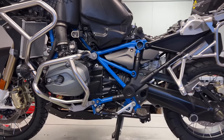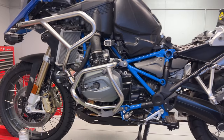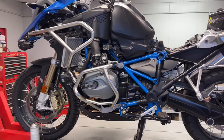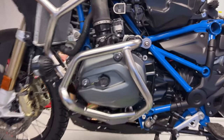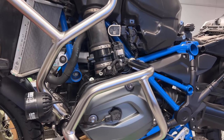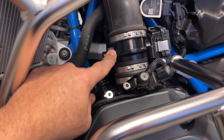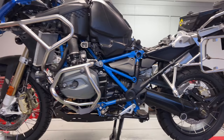Everything linking and what goes to the throttle bodies is coming directly from the DME. The fly-by-wire throttle gives information to the DME, calculates all the stuff, and then sends it to the throttle body. So they want those cleaned as well. But, you know, I was talking about the carbon, or not carbon, but what looks like old dead fuel in both cylinders. And there was a little bit of etching, like the fuel had built up, and where the throttle body pivots in here, it was etching a little bit. So I sent them pictures of all that and see what y'all think on that.